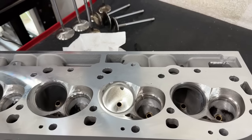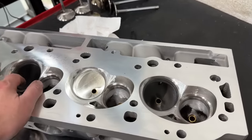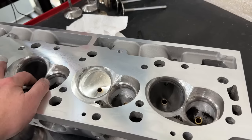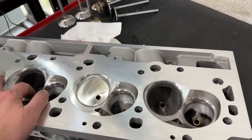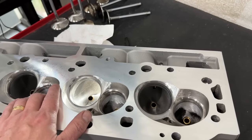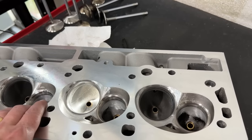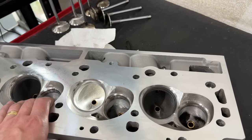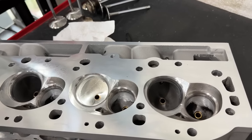If you go back in time, a guy named Dominic — who has his own YouTube channel called DZ Performance — brought a 496 dyno mule for me to test. It's a hydraulic roller, a small cam around 240-something duration. We tested a whole bunch of different heads: these Pro Max 317cc heads, their 290cc heads, the AFR 265cc head, the Brodix Race-Rite 270 oval port, the Brodix Race-Rite 294 oval port, and the AFR Enforcers.